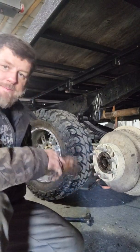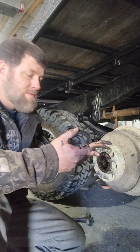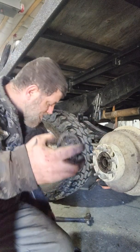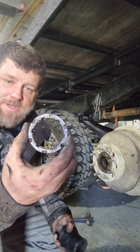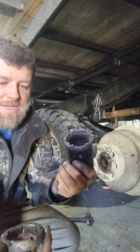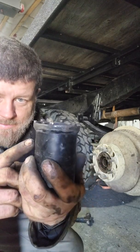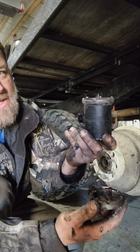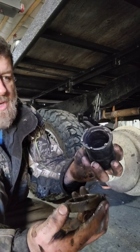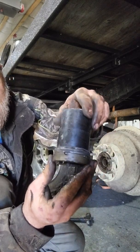I'm here with this full-float rear diff on my Chevy — it's a K30, one-ton. Full-float basically goes for any model. You're gonna have this nut here, and you're gonna need this socket. This socket is the same thing you're gonna use on basically any 70s or 80s Chevy. It also fits your front diffs on your three-quarter ton, anything four-wheel drive for a Chevy. It locks in like that.